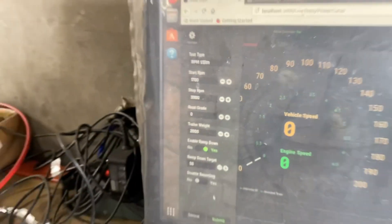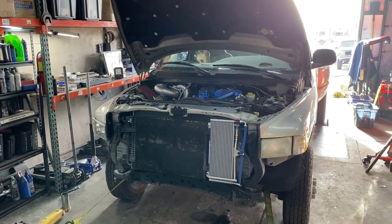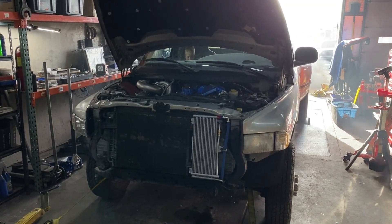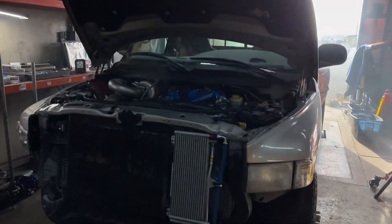We're going to use our test window. It did 660 horsepower, 1570-something foot-pounds of torque. Those are really good numbers for 5x14s with some OATS, 5.5 DVs, and a hot rod lift pump. Now what we're going to do is run it one more time to validate the test - and I'll tell you what, it sounds really good. We'll go over the graph here in a minute.